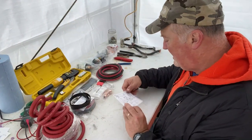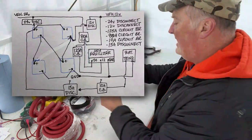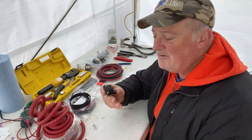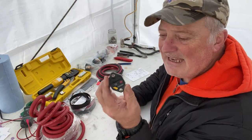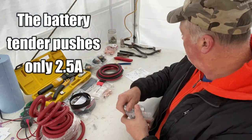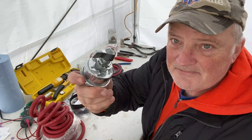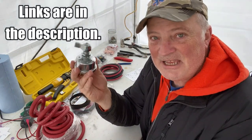I don't have all of the parts that I need, but here's the diagram. What I'm going to do is take this one bite at a time. The first thing I want to do is try to isolate the battery tender, and I'm going to do this with a 10-amp circuit breaker and a 15-amp shutoff switch — a battery disconnect, but in this case it's a tender disconnect.